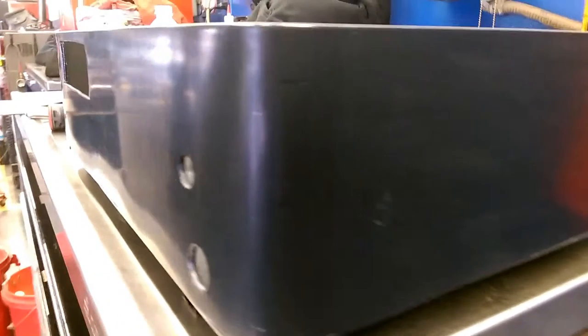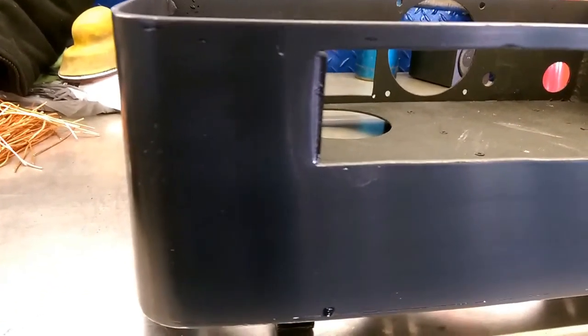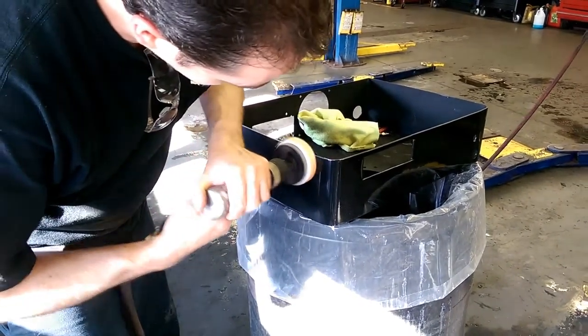Here's what it looks like after you're done wet sanding your clear coat. You can see all the imperfections in the metal — make sure you take note of those too, because I'm going to be referencing back to them. After you're done wet sanding, you're going to have this matte, kind of brushed appearance to it. But the clear coat is still there; all you really did was smooth all the orange peel down. The surface of the clear coat is actually very smooth at this stage, and this is where you get into polishing, which brings that shine back.